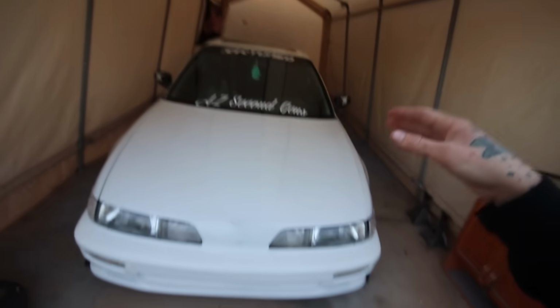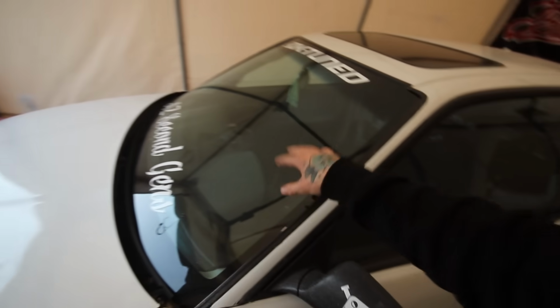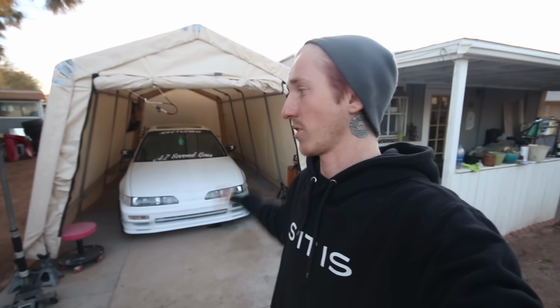I'm going to start off with pulling the car out. Essentially what I have to do is take the hood off, the fenders off. I'm going to take the whole front half of the car off. I have to take the doors off, remove the windshield, and remove the dashboard, my shifter box, my seat, my carpet, everything under the dash. So that's a lot of work as is. And if that isn't enough, I've also got roughly 170 spot welds to drill out on just this left-hand drive car right now.